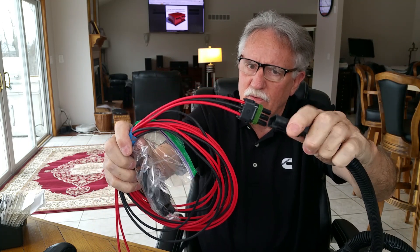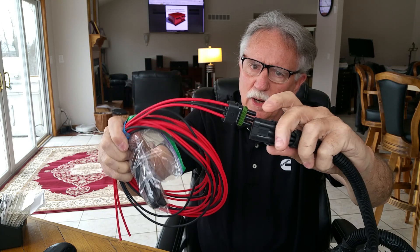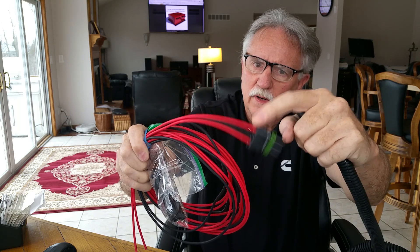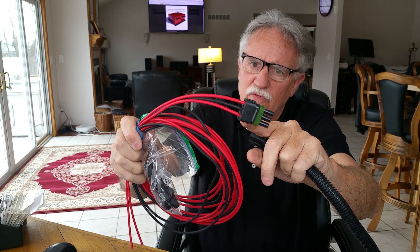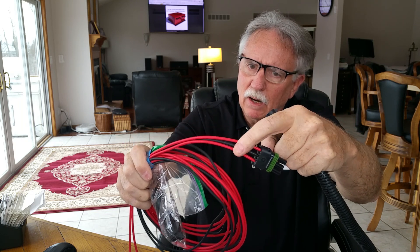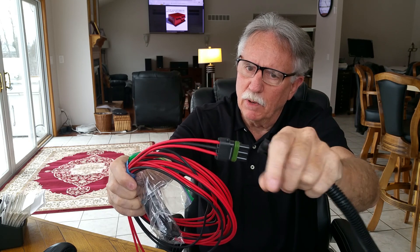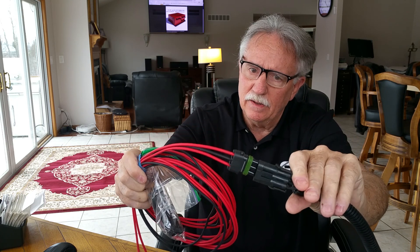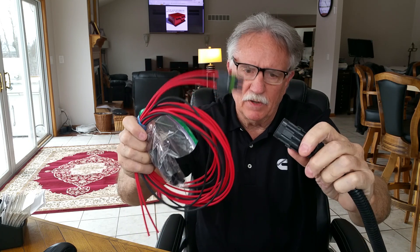This connection is really important. I've sold brand-new harnesses where the new harness never had the right plug to connect into this OEM harness going from here to the batteries for ECM power. What happens is this gets corroded so badly that the barb slips out and actually backs out of the harness. You think you're plugging it in, but it backs out a quarter of an inch and you're not getting ground or hot — so that's the tip of the month.